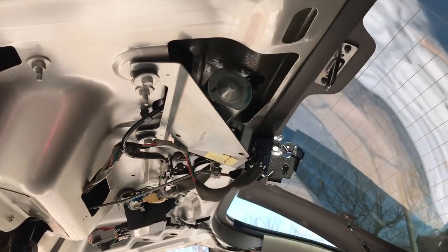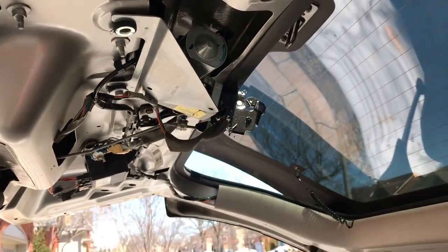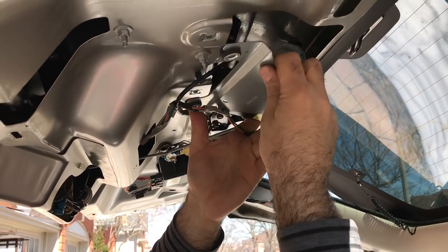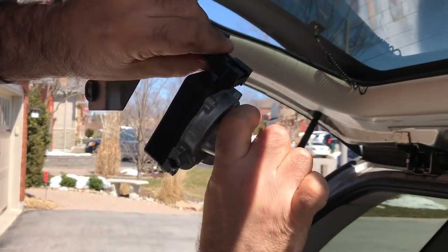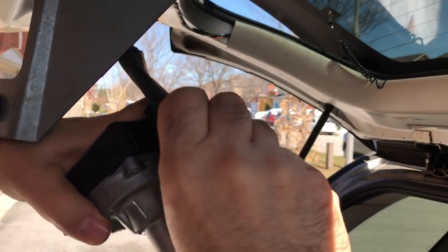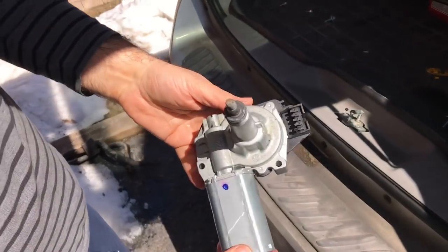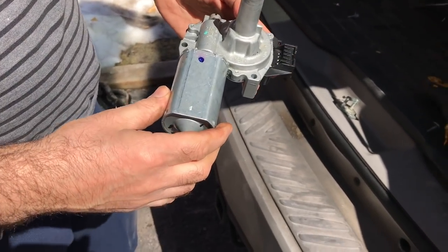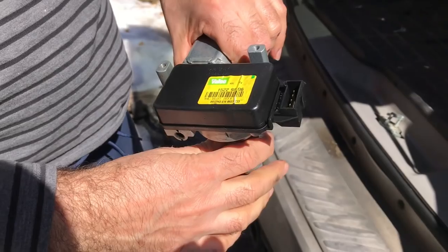I think this bracket's going to have to come off because we need to be able to pull the motor straight out. There we go — and the motor is out. So what we're going to do is remove this plug here. Looks like there's a little tab — you pull this up to unlock it and then this should pop up. There we go. So here's your motor for your rear wiper. Normally this will not require replacing unless it's not working at all. What we need to do here is this shaft's going to have to be removed from the unit.